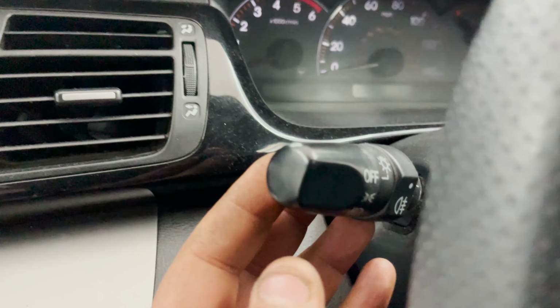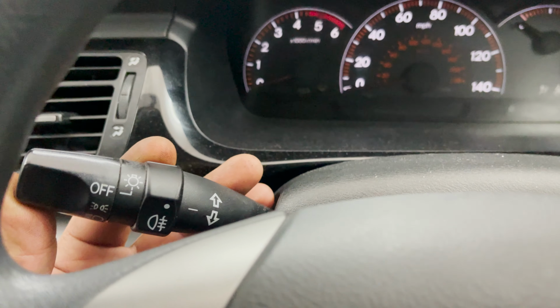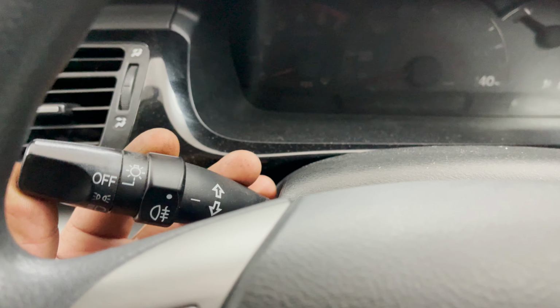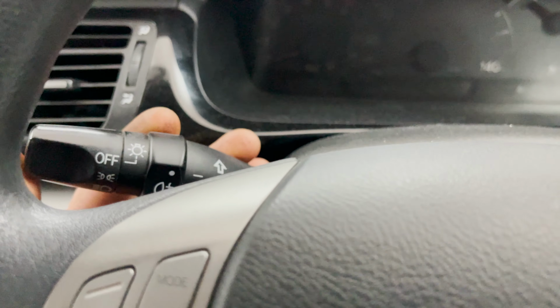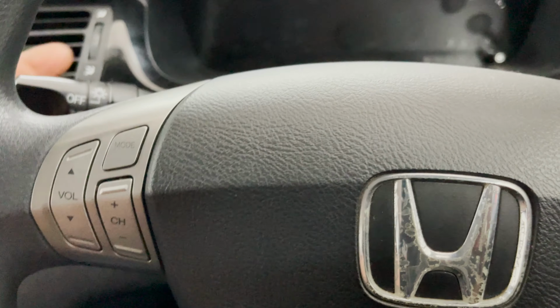I can definitely hear it, and it's not the stalk, because when the ignition is not on, I don't hear it. You see, there's no noise from the relay. So I think it's a pretty easy, simple system, but there is a body control module in a way. So I think I'm just gonna get to that relay and see what's going on there. Could very easily be just a relay issue, and I can swap them out just to test it. I'm pretty confident the stalk is working, and our issue is gonna be downstairs.